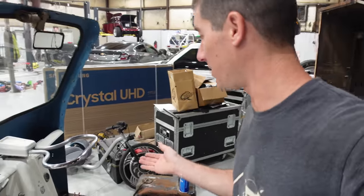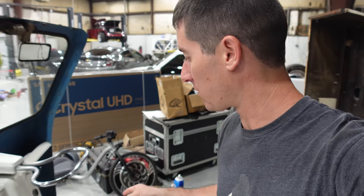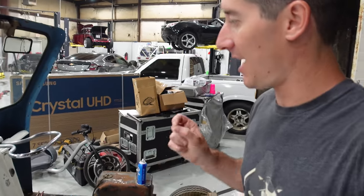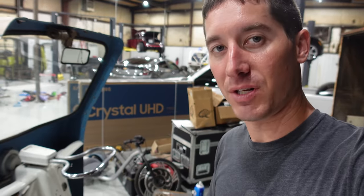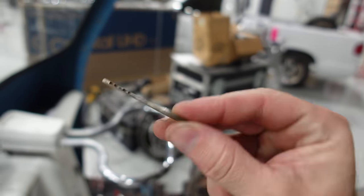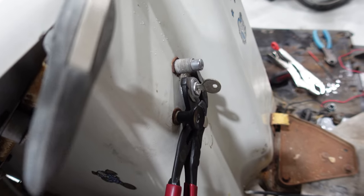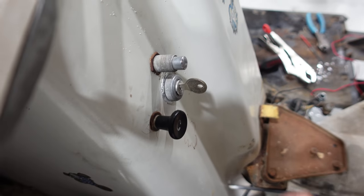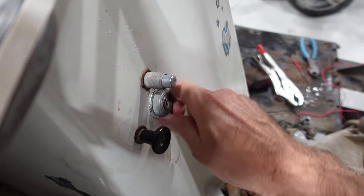There's no reason the thing doesn't run. Everything was new — the coil was new, the condenser was new. We went in on this thing, but when we got it working, it worked fine on the original coil. So the original coil is actually back in the golf cart now, and I'm going to pull the switch out and go see if O'Reilly's has something that will drop in. The only thing that's tough is this isn't a super generic key like most ignition switches — this is a real key, which I'd like to maintain. This key switch has a nice knurled nut on it, and it comes loose. Look at that — I couldn't have asked for a better outcome. She came right off.